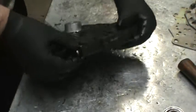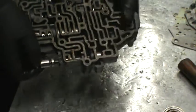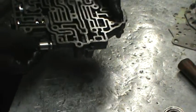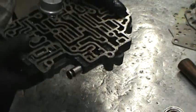This is your selector valve. This is basically what's hooked to the shifter — when you get that feel in the shifter, you're moving this. All you're doing is moving a hydraulic valve; you're actually feeling against the spring when you're clicking it into gears.